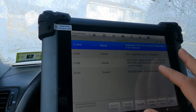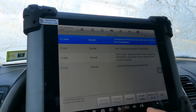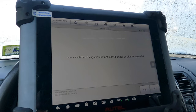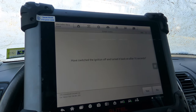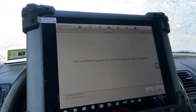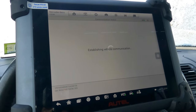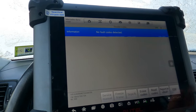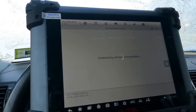You can also erase faults from within the control unit, report to cloud, and so on. I'm going to try clearing the faults here — it says switch ignition off and leave it off for 10 seconds, then switch it back on again. After 10 seconds, switch the ignition on and hit yes. This will give us a good indication whether that fault is still there or not, because sometimes you have to go into the actual control unit.